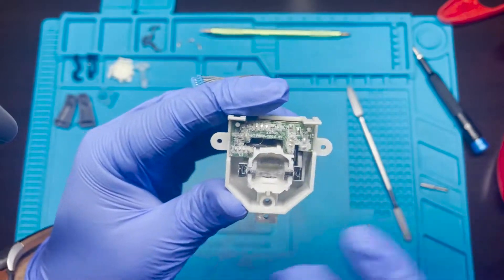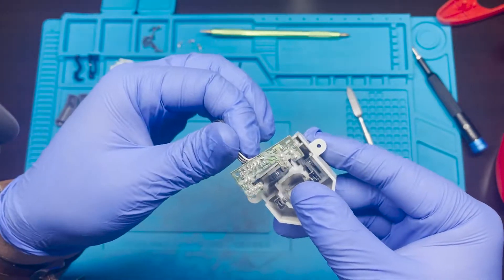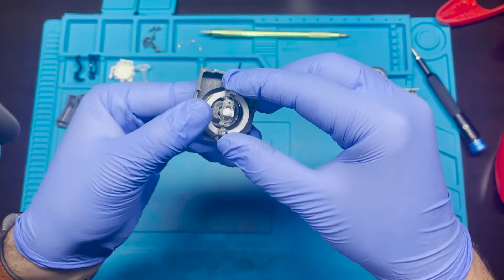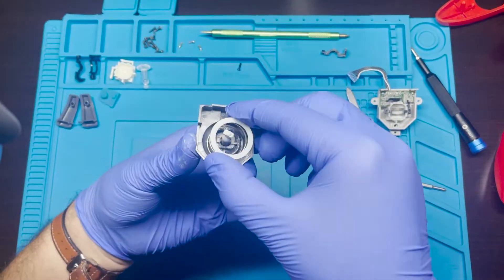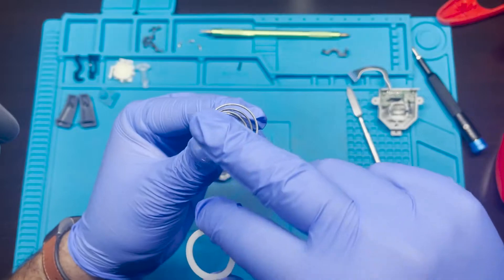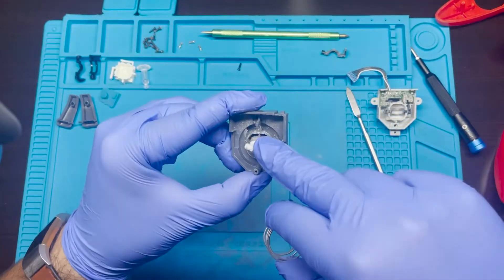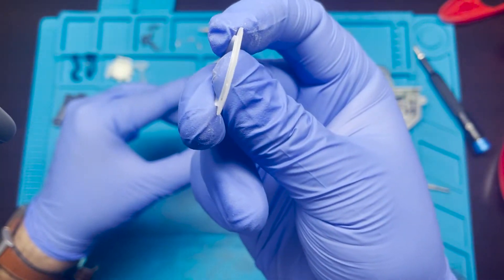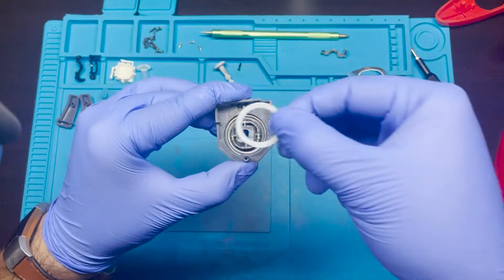This is kind of the other black piece — this is the longer one with the axle or gear portion that handles the rotation on the right side. Let's take a look — this is just pretty dirty. We're going to go ahead and clean this board up; it's a little tiny one. We're going to have to put this back together once we're done, but we're going to go ahead and replace everything. We're going to take this out — just turn it to the side, hold it, and then turn it to the side. On the spring, the smaller side ends up facing the plastic, and this plastic piece has a groove — it's going to go inside and fit into the wider part of the spring.